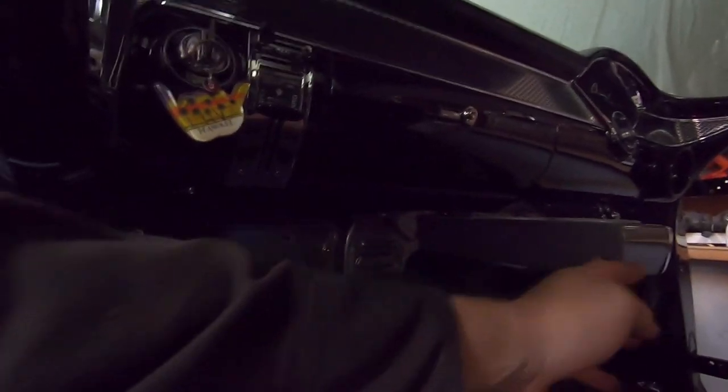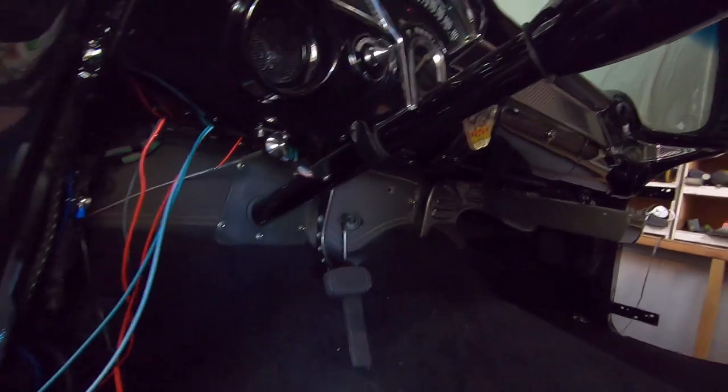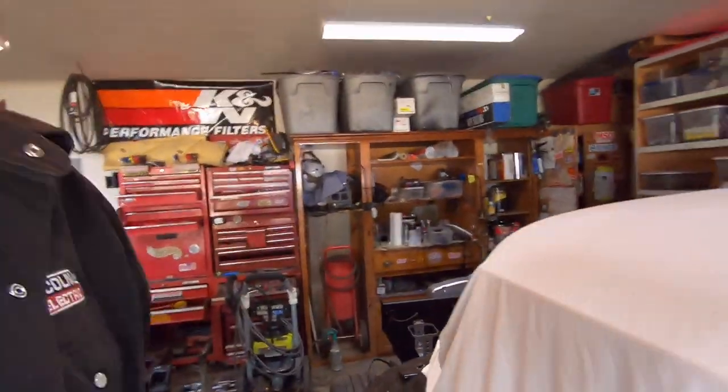Welding the studs in like I do it - I have a stud welded on the firewall in the back side for the heater box to bolt to, with an acorn nut and washer on there for looks. To me it's just a lot cleaner looking. I don't mind doing a little bit of work like this because in the end it's a good-looking job, nice detail. Probably about an hour total by the time I'm done polishing and grinding and rewelding.